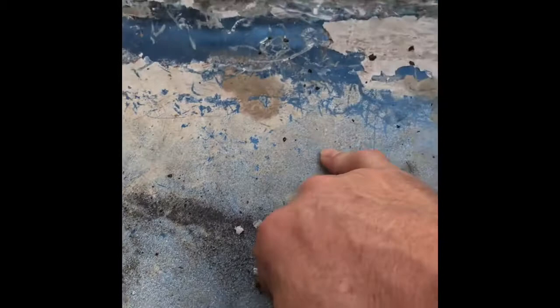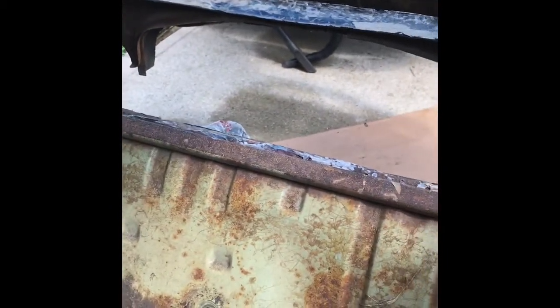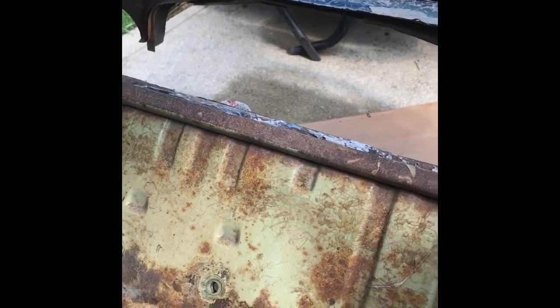The next thing I'm going to do is remove this piece here. I'm going to use the edge of the bottom of this support to leave as much structure of the car as possible. I'm going to get right under and cut along this edge and this edge. I'm not going to film that part because it's straightforward — just take an angle grinder and cut through it.